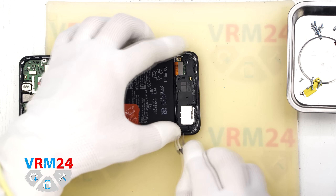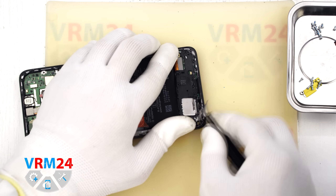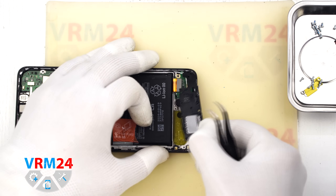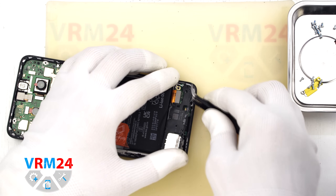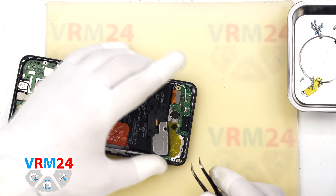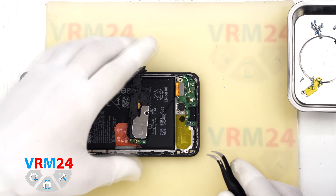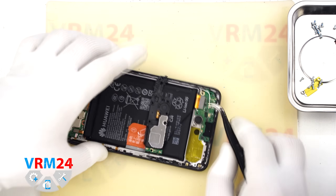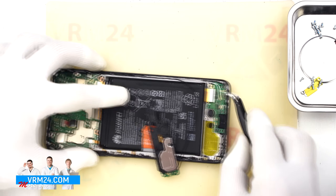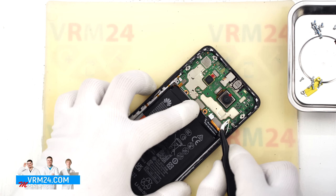After removing the screws we need to detach the speaker module. Gently lift from the correct spot and separate the speaker block. In our case removing this module can be tricky because sealant has seeped into the speaker's openings. Now we carefully disconnect the speaker module, flip it over, and we can see that the coaxial cable is connected to a small antenna board on this module. It is best to first disconnect the interboard flex cable, free the coaxial cable from its channel, then unplug its connector from the mainboard and set the speaker block, antenna board, and coaxial cable aside.